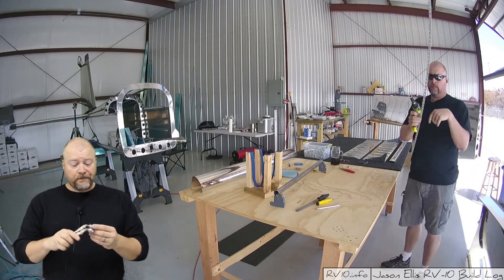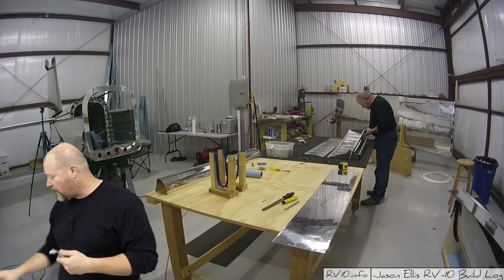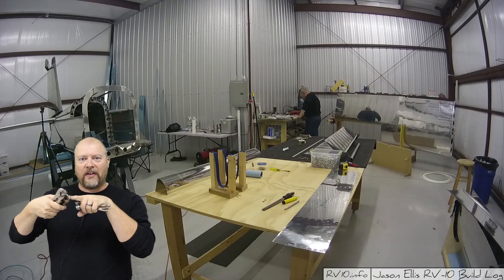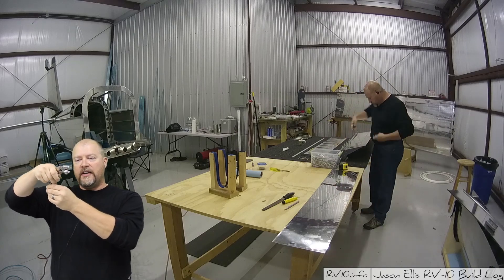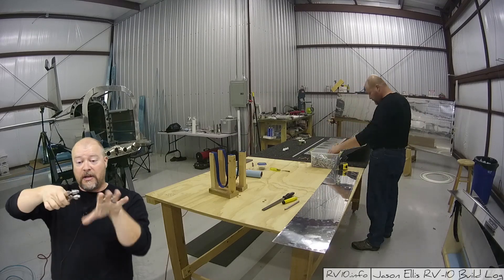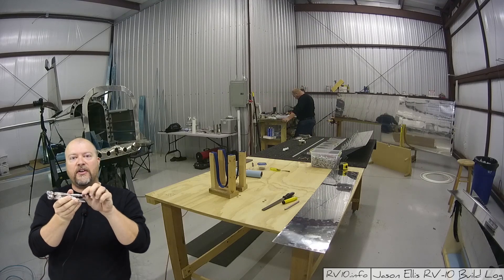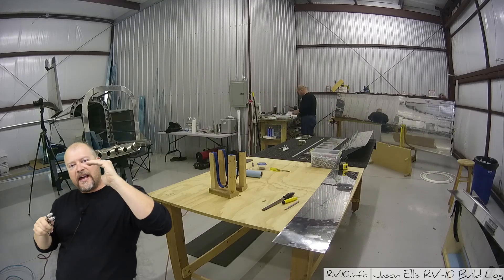They make a tool — it's one of these vice grip tools. You're going to see a lot of these. I've got a bunch of different vice grip tools where they literally just weld a tool onto a vice grip. This one is designed so that when you put the aluminum skin in here, you give it a crimp — and you don't do it very tightly. In fact, you should be able to almost lift it straight off. It's such a loose crimp. They even put a nut on the end so that you don't overdo it. You put it on there and pull it along the skin to give it that ever so slight bend.